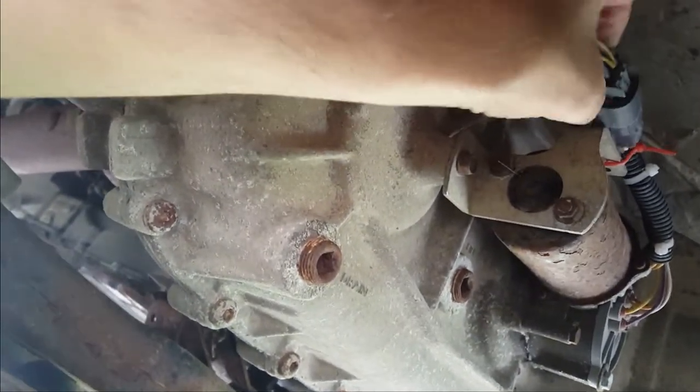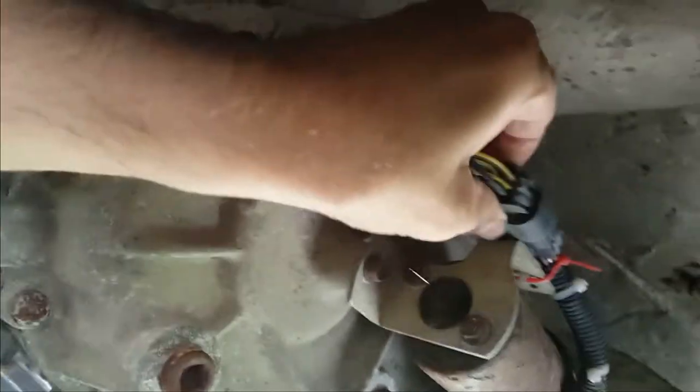And this is the motor itself, and I'm going to undo the connector here. First, I've got to pull out the little retainer clip. Might need a tool for that, though. Well, there it is. That little retainer clip keeps the connector from coming apart. And once that's out, I can just push the little release latch, and I should be able to get the connector to come off.